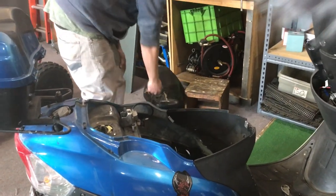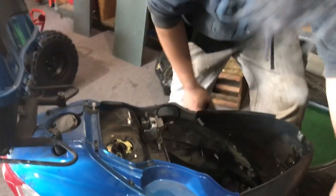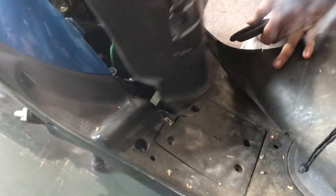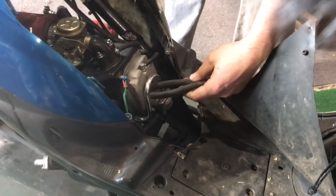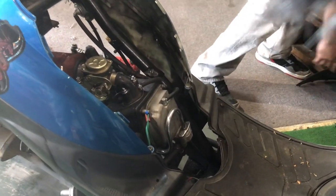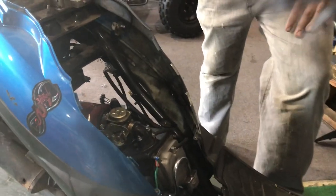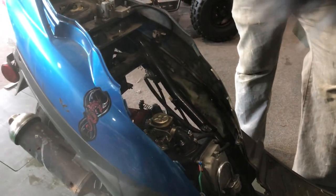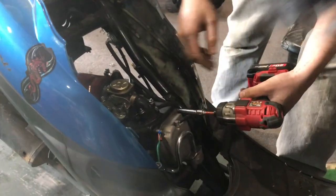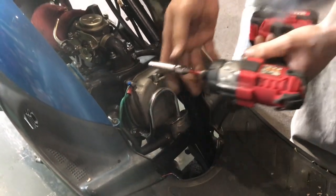This is how you gain easy access to your valves on the scooter — you have to remove that bucket seat. To get to your head cover, there are two screws here, though this scooter doesn't have any, so it just pulls right out. There's your head cap. The head is where the intake manifold is, and you'll use an 8 millimeter socket — the seat bucket used a 10 millimeter. There are six bolts you need to remove.